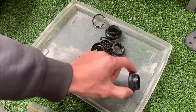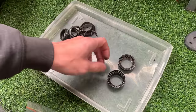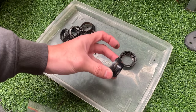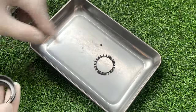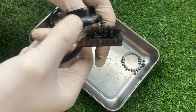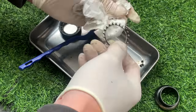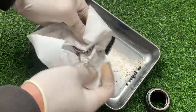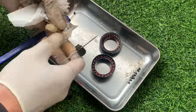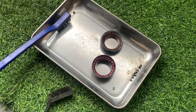Just sorting out a headset here. I'm going to put the old one on the Diamondback I took apart. The bearings looked slightly different sizes, so I decided to put new bearings into the cage, clean it out, and use this headset. I'm cleaning off some spray paint — I'd previously sprayed the headset cup with the frame on the old Diamondback and some paint came off pretty easily, but some was really hard to get off, testament to decent bike paint. Eventually got it off using a wire brush, then cleaned out the race, replaced some bearings with grease so they'd stick. One extra bearing left, so lucked out on that one.